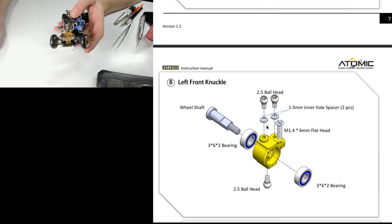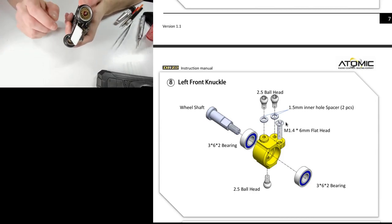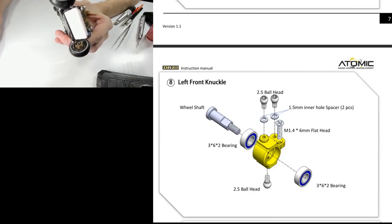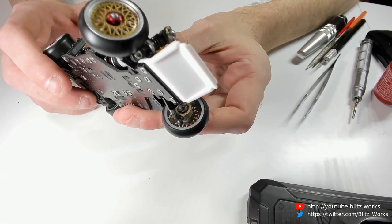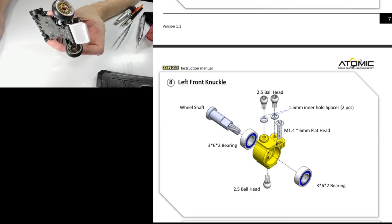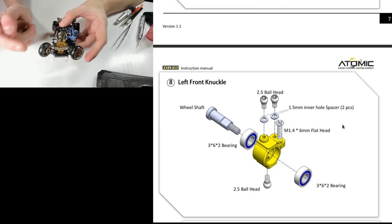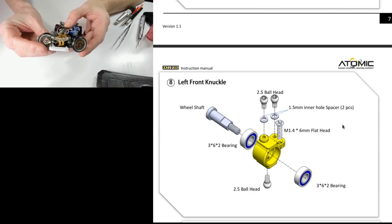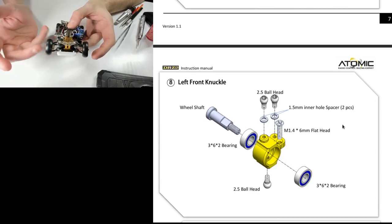It's kind of nice having the camera and lighting dialed in — it really makes this a lot simpler. This screw I found binds on the inside of the wheel — it's very very close — and I actually had to file that down because it was binding. If I did this again I'd actually just leave that screw part off. The reason is it doesn't actually do anything useful — you'd think it limits left-to-right throw so it doesn't overturn, but there are other parts that interfere with the suspension way before that, and the only time it takes effect is if the wheel is slightly depressed.